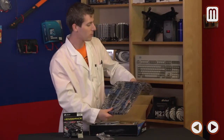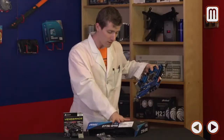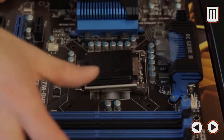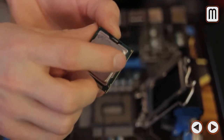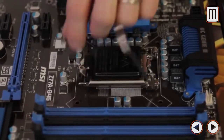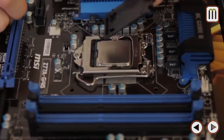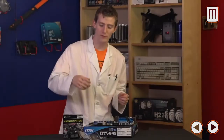Next is the motherboard itself — remove it from the ESD bag, which protects it during transport. Place it onto our makeshift test bench, being careful not to touch any of the sensitive electronics. Installing CPUs is very easy now: lift up the retention arm, lift up the hold-down plate, no need to remove the protective plastic cover yet. Align the little gold triangle on the top of your CPU with the triangle on your motherboard, then close down the hold-down plate and retention arm. The plastic cover will pop off and your CPU socket pins were never exposed.